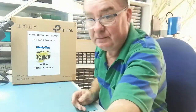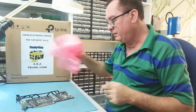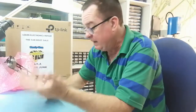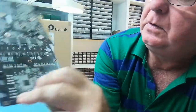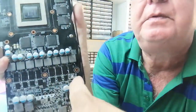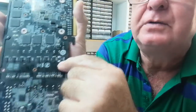There's one more thing in the box. I found this on one of the stalls — it's obviously part of a graphics card: no heat sink, just the circuit board. Straight away you can see some capacitors are missing where they've been desoldered. On the other side there's a transistor or FET missing too — that's the most obvious damage. There also appears to be one missing from a row of capacitors.